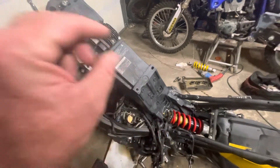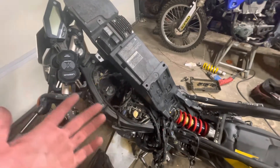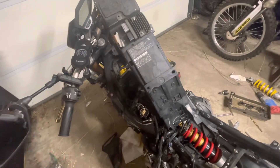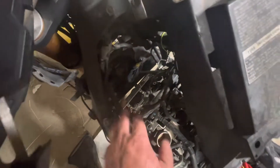Once it got to operating temperature there was just a slight drop in power, and I noticed it had a hard-to-start issue once warm. Me being a mechanic, knowing full well what that means — it generally means, with overhead cam Yamahas, that your valves are too tight, either the intake or the exhaust. In my case, the intake was fine.